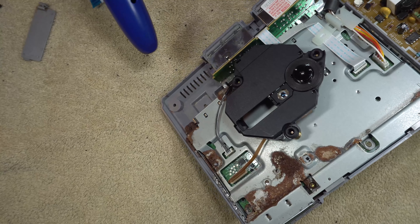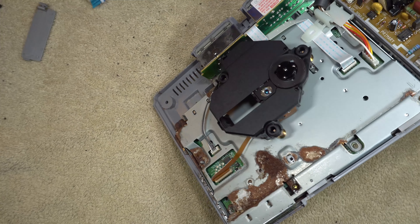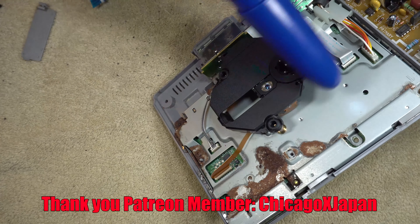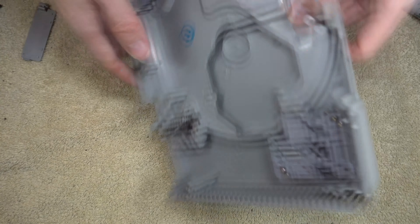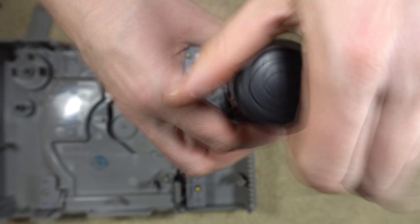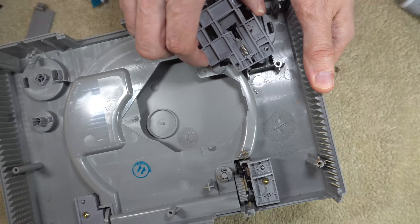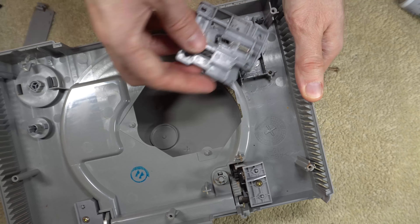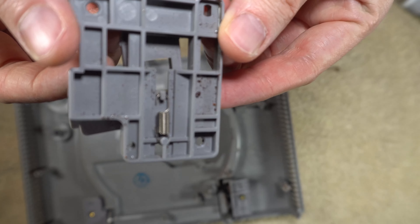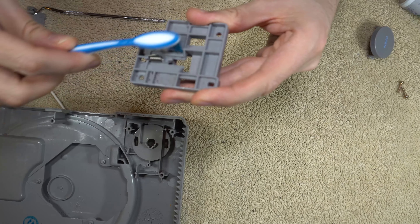What I'm going to do is use my air blower and blow that stuff out. While I'm blowing that out, I just want to thank my Patreon supporter ChicagoXJapan for helping to support the channel — I really appreciate it. With that cleaning out of the way, I'm now going to concentrate on the button that gets stuck. The mechanism is held in by screws, and it's basically two pieces of plastic and a spring connected to each other. There is residue in there and it's very sticky, so I have a feeling that's what the problem is. I'm just going to give this thing a very good cleaning.